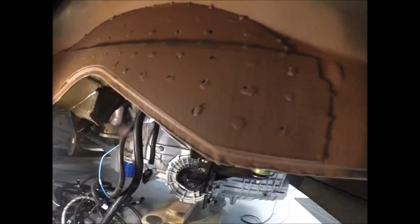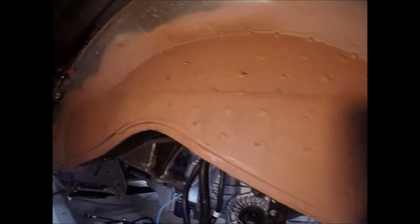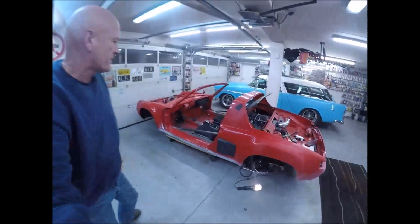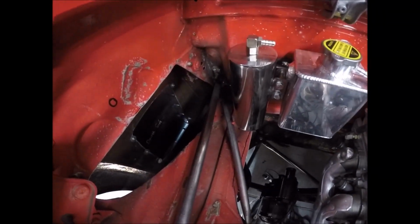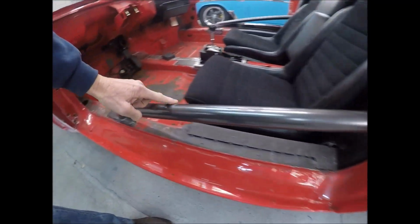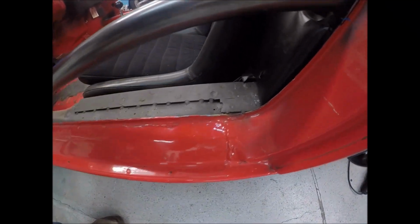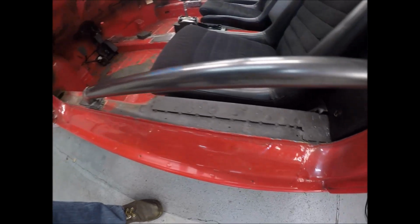this stuff. And again, here's all my reinforcement, plug welding stuff, just to stiffen everything up back here a little bit. And then if you notice back there, you see where those 2 ties come in? Those actually come in right here, cross support, and bridge right over here, and go down here. And then again, I've plug welded the crap out of some really thick, I think this is 2 millimeter right here. So it's pretty thick.